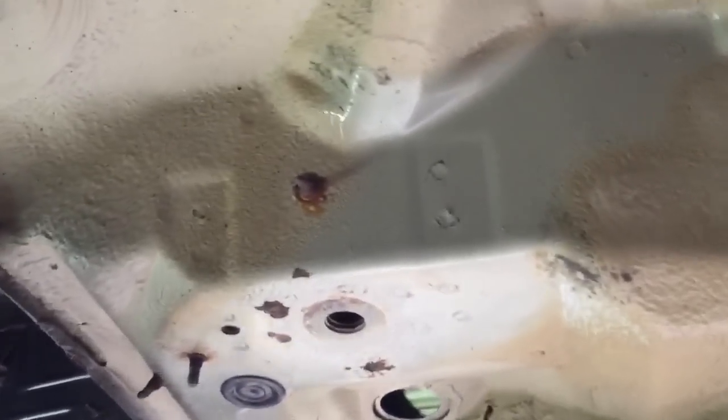Right rear, got a little bit what looks like something around that spot weld. Yeah, that is a crack. Yeah, again, before cleaning the grease off, there was nothing there. And notice we haven't used a wire wheel or grinder to do this. A lot of people don't worry about the dirt and just go straight in with the wire wheel or the grinder. All you're doing there is smudging the cracks.